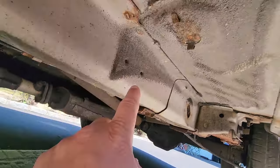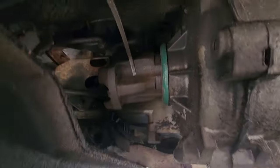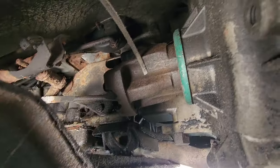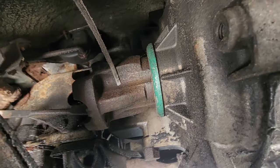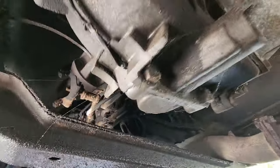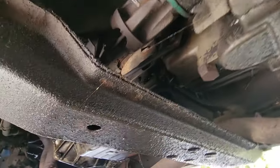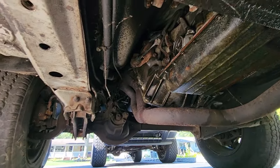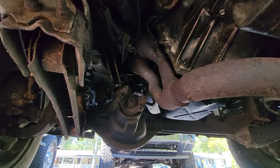It's looking really nice. Unibody frame rails — rust free, which is great for a New York Jeep. But right here, look at this — we are missing a front drive shaft. Right here is the transfer case, and no drive shaft. So I was thinking, since it's stuck in part-time, we might have a transfer case issue. This could confirm it. Maybe it's the linkage, or maybe there's a bad front end — since the front end is disconnected, I think it might be a transfer case problem.